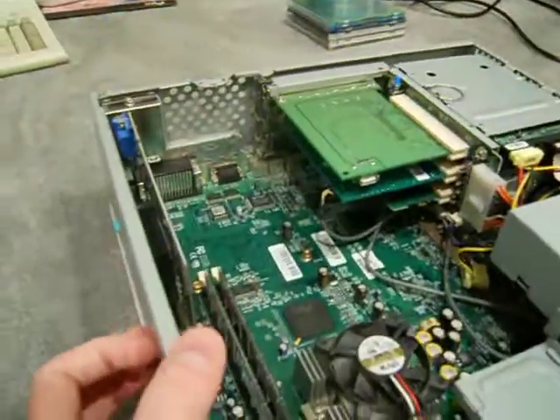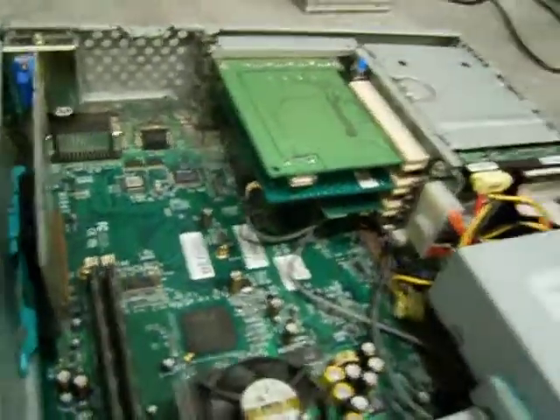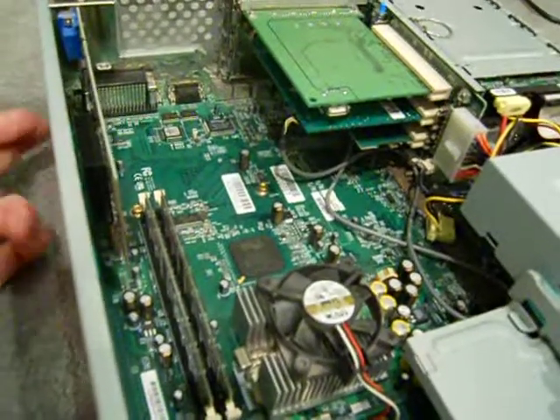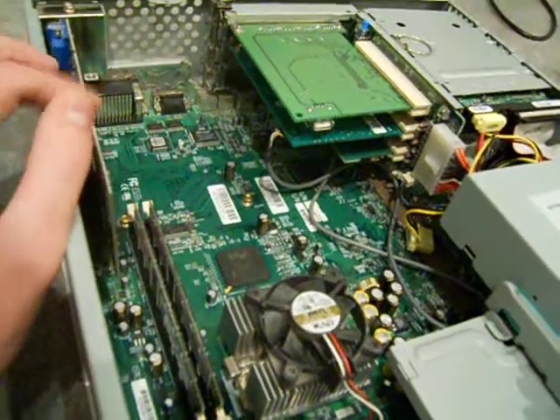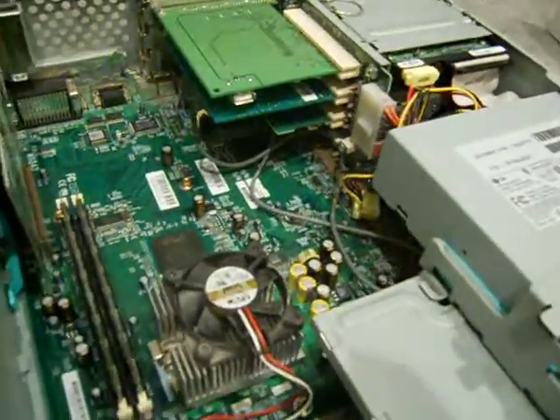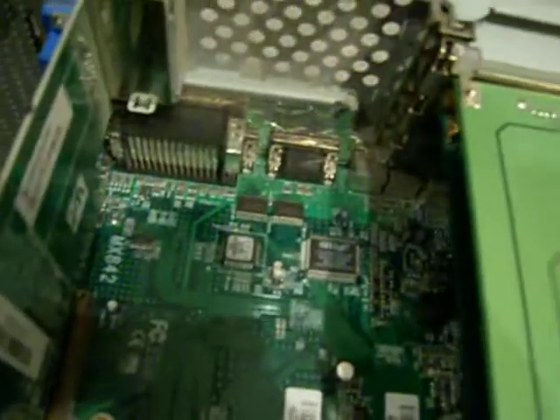This computer runs Windows XP flawlessly — I already had it running XP with a couple of programs installed on the hard drive, and I'll make a separate video on that. I also had to replace the CMOS battery because every time I started the computer it would say bad CMOS, please check system and go to setup — it wasn't holding the date and time anymore. You can see chips in here for the integrated audio, and it also has integrated video in addition to the video card.